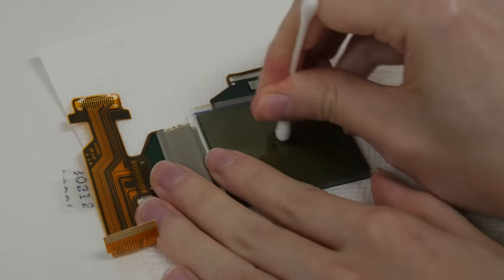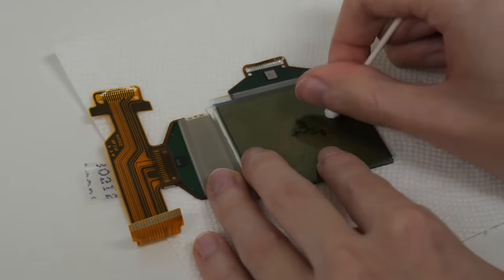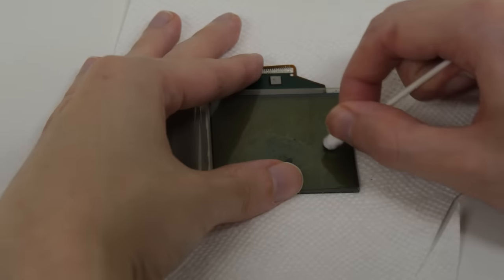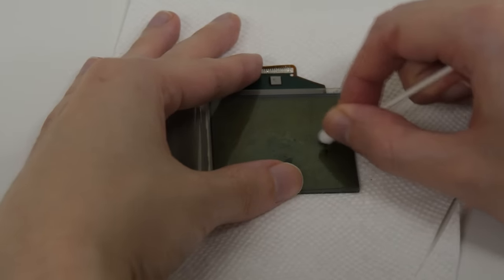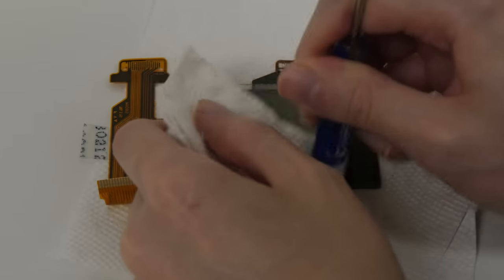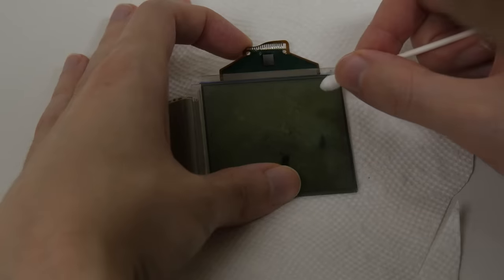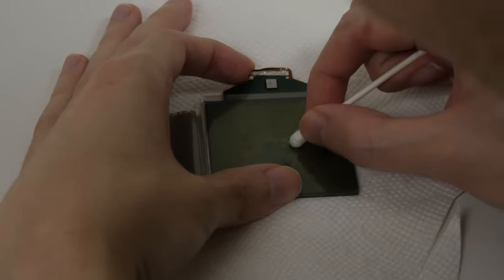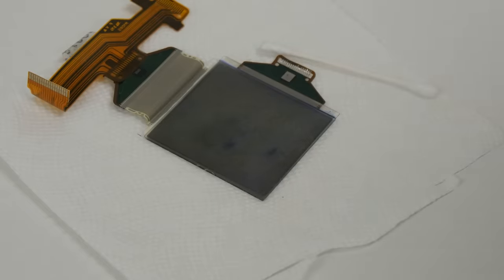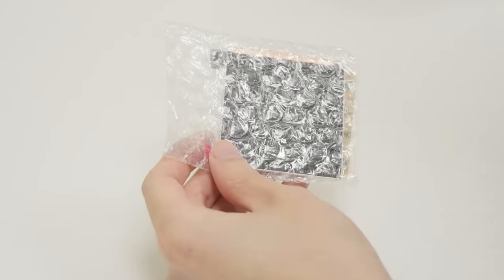Amazingly, it didn't take long to start seeing results, especially the thinner strands, which disappeared almost immediately. After about 20 minutes, it was looking very different. I was kind of staggered — I'd spent my whole life learning not to poke or stab LCDs, and now I'm mashing Q-tips and screwdriver handles into one, supposedly for its own benefit. Unfortunately, I soon discovered that as one blotch disappeared, another would take its place. I could see that eventually this would probably all clear up, but since I already bought a replacement, which should be better in every way, I decided to just go ahead with installing that instead.